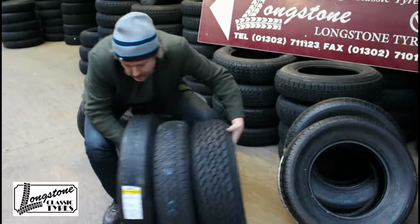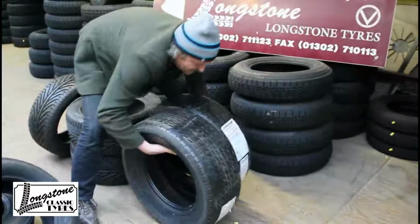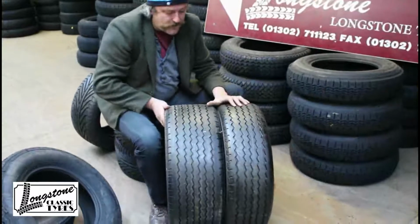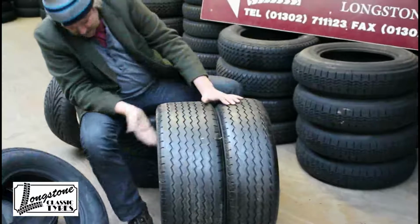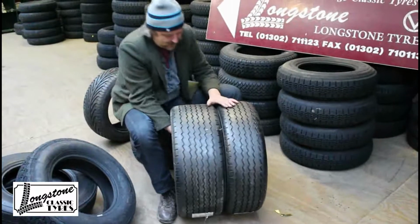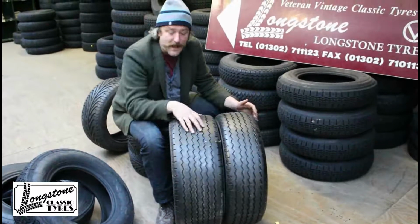So that's when we come into the Avon CR6ZZ range. So, you know, here's just an example of a couple of tyres. This is a setup that some people might go for. That's a 225/65/15. And this one is a pretty big, it's a 275/55/15. You know, the difference in diameters is minimal, so that's fine. That'll be a front and that'll be a rear.